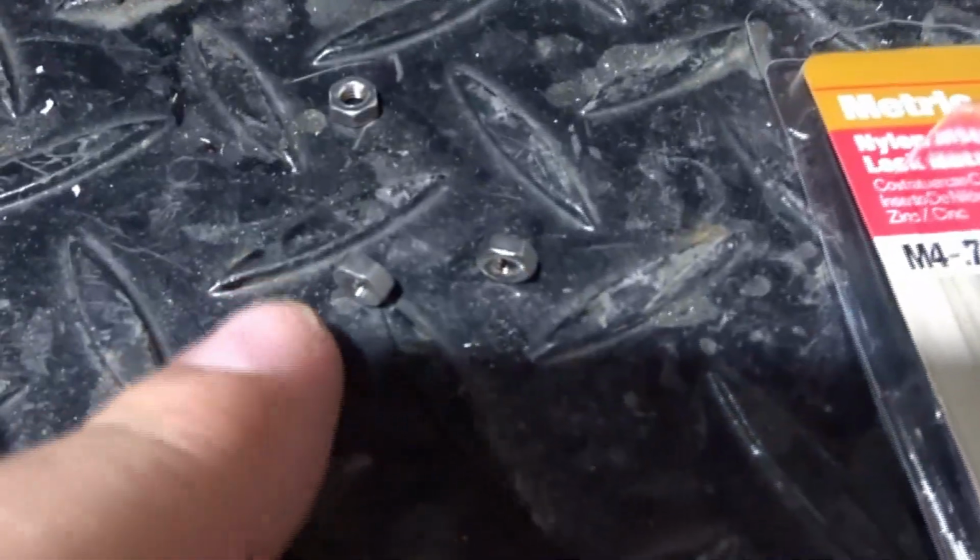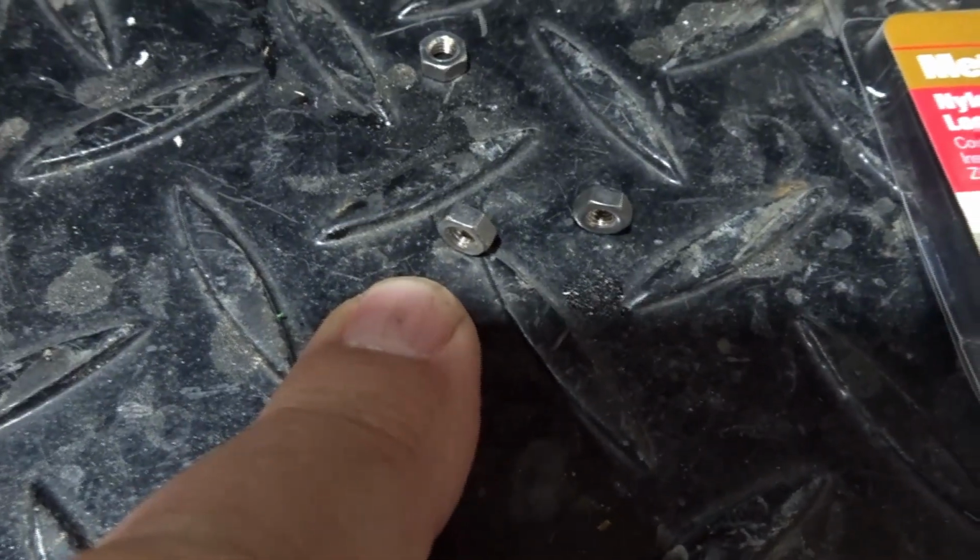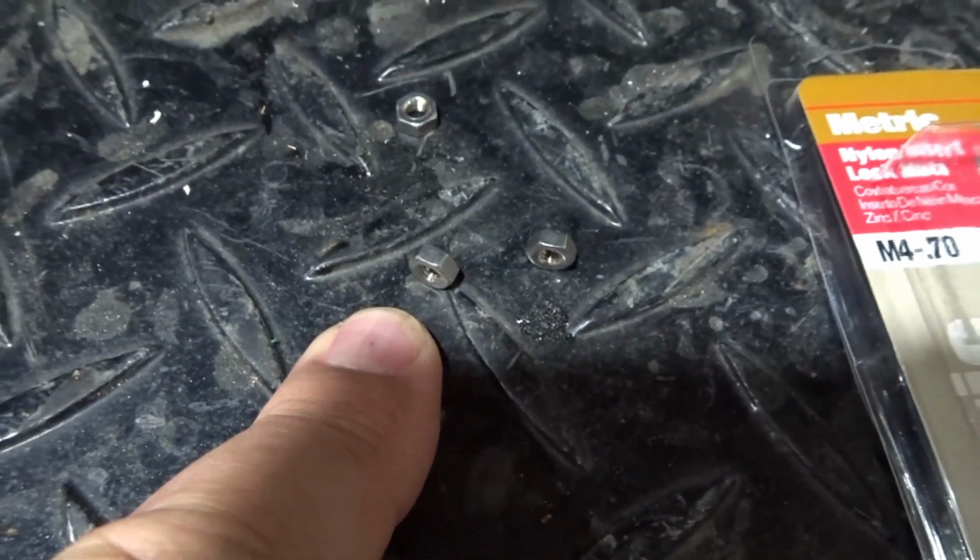It is the next day, and I am going to make a little bit of a recommendation to all of you that are running the single rear tail light on a Mark IV, a Mark V, even on a Mark III. If you're sourcing your taillights from, I think it's Pacific United, you may want to change out the hardware, the actual nuts that they use on the taillights, because they are no longer locking hardware. They don't even provide you a locking washer.